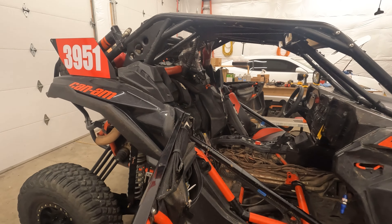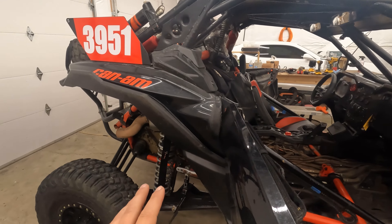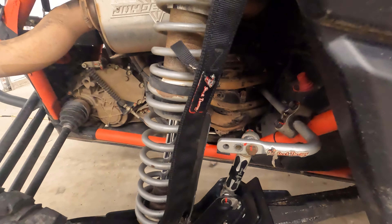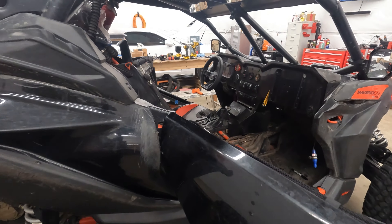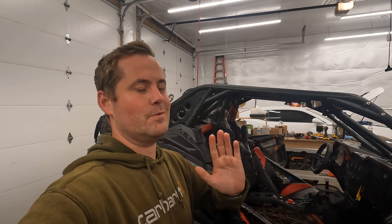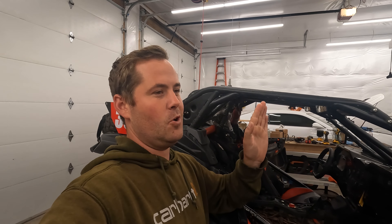Once the charging system goes out, the voltage on the X3 drops rather quickly. It will still run at 11.1 volts, just so you know. Pretty scary when we were up in the Cascades — apparently they're releasing grizzly bears out there now, so I was motivated to get back to the truck. Got it back to the shop, did all kinds of stator and voltage regulator tests online, and at some point during testing it magically fixed itself — which we all know it didn't really fix itself.